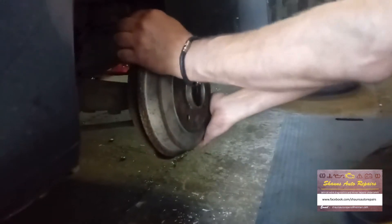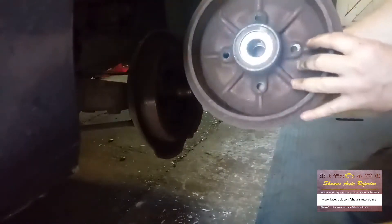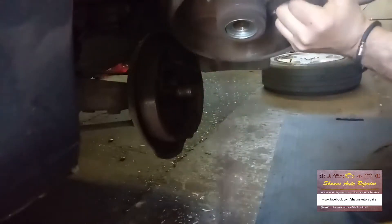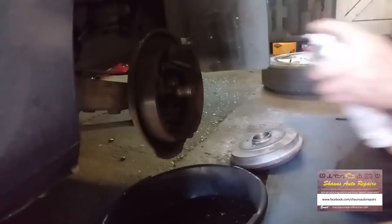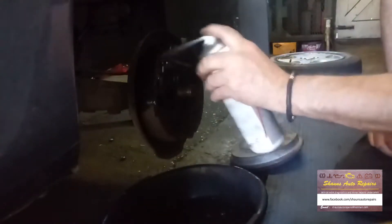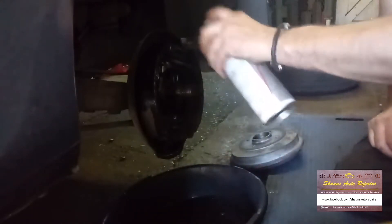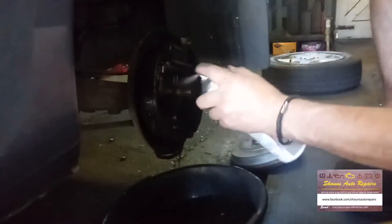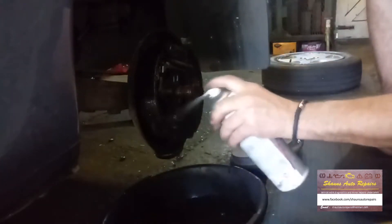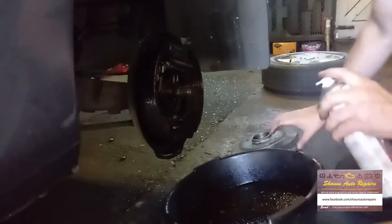Like so — there you've got a fixed bearing in the middle there. There's plenty of brake dust, so we'll give that a clean out first of all. A nice little dousing of brake cleaner, and the same for the inside of the drum as well.